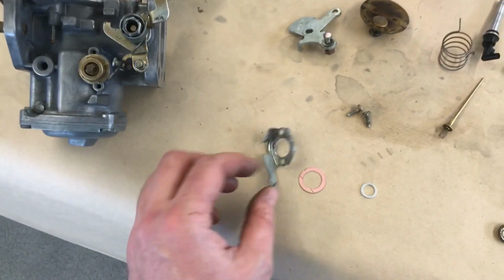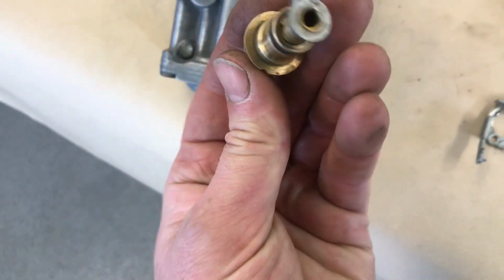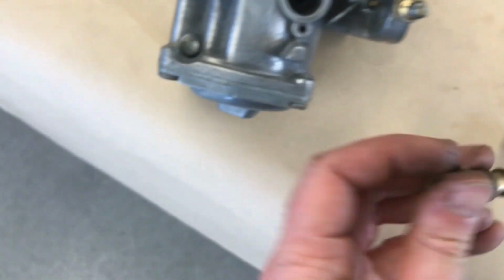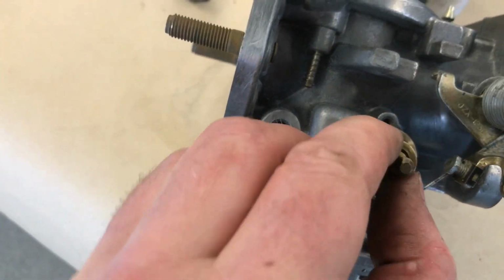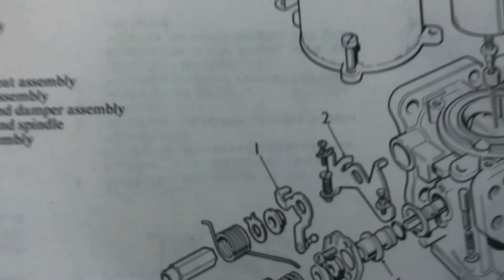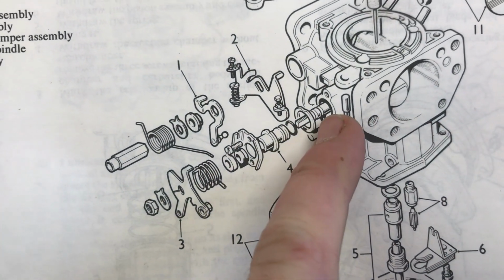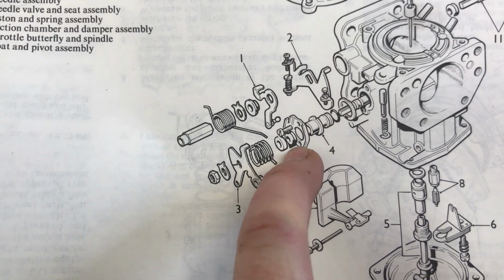Under the top. And then that sits on top. There is actually a little indentation there, and when you look, the same here as well. That's because it goes that way round, and the head of one of the bolts actually goes through there like so. That should help you get it all the way round. If in doubt, we have the workshop manual here. So yeah, there's some kind of felt washer, O-ring, then seals on the outboard end.